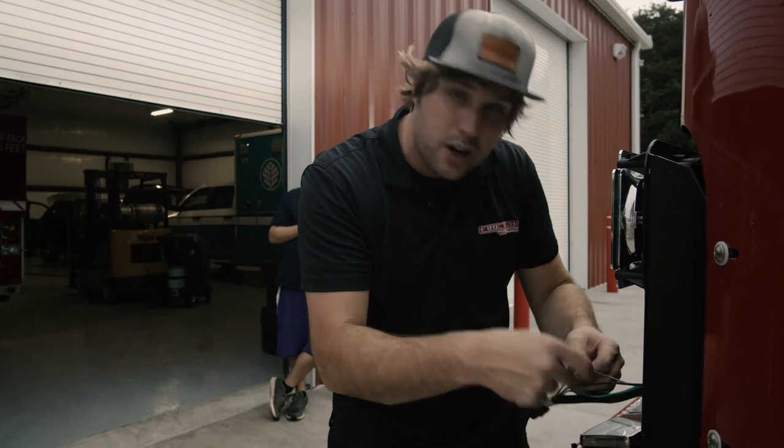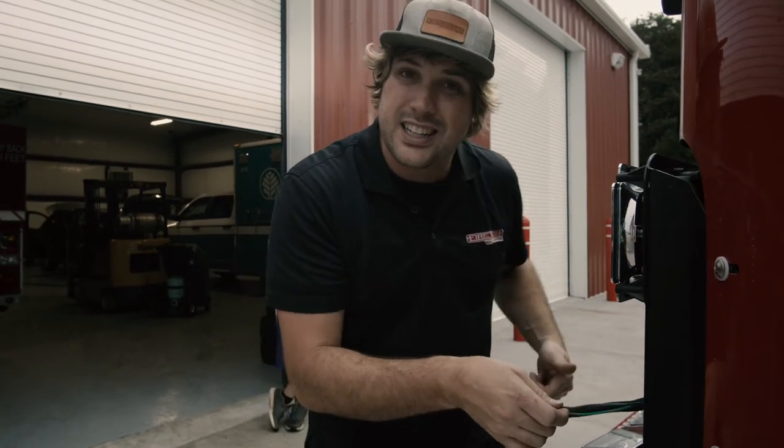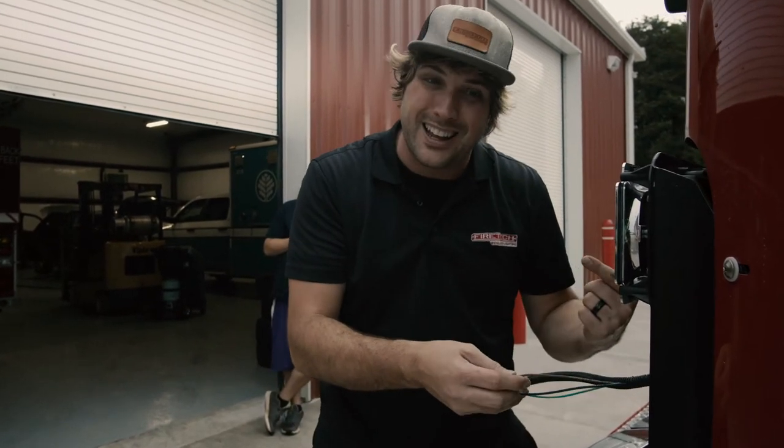So that's the circuit we want to tie into, so we're going to cut it, we're going to solder in our connection, tie it to the headlight halos — there's the white wire on the back of the headlights — and you'll be good to go.